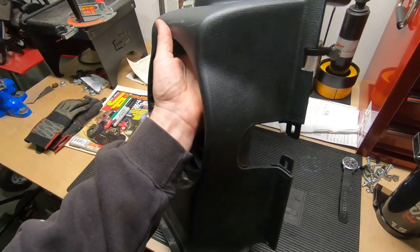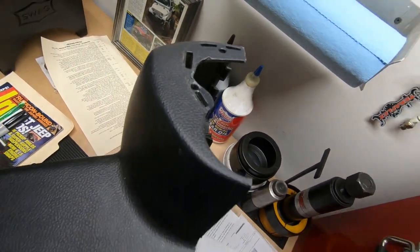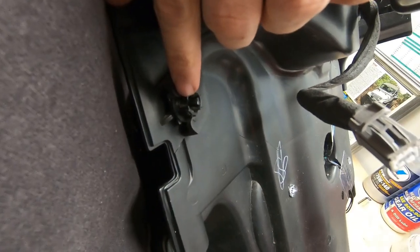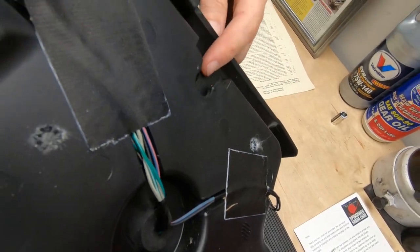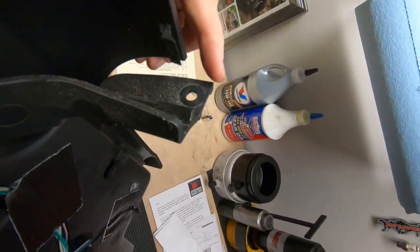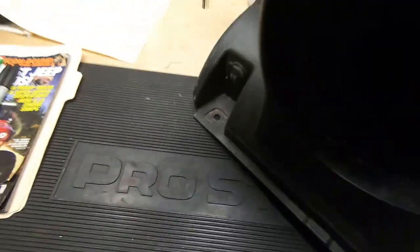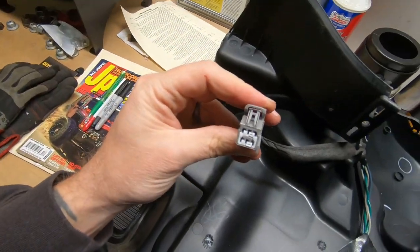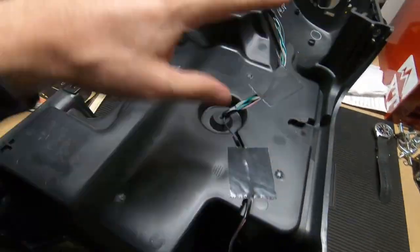If you want to pull this out, you've got to take a plastic clip off the top where the seat belt goes through and kind of separate it. There's one pin here, another pin in the front, and then there's one 10mm nut on a stud that holds this in and the whole thing comes out. There are also two Torx bits on the bottom. Then you disconnect the one quick disconnect connector and off she comes. There's your 12-volt power outlet — it's all self-contained to the unit.